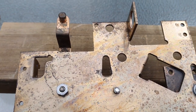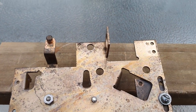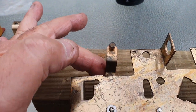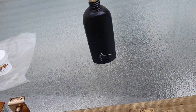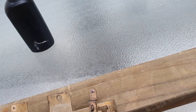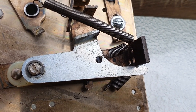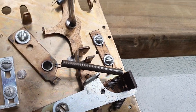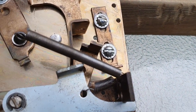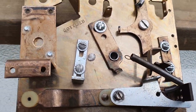There are different styles of reset arm. This style has to have the Bakelite bit fitted on for the coil plunger, and a C-clip holds that on. Once fitted, it's important that you make sure the drive pawl is to the right of the arm. I put a drop of fine oil on the shoulder screw. You must undo that nut — in some of the later ones they seem to burr the screw over as a preventative measure to stop it coming off. Tighten the front screw so it binds, then turn it back just slightly so there's no too much side play — that's absolutely perfect.